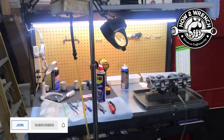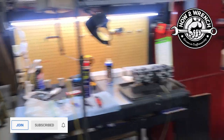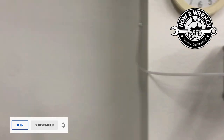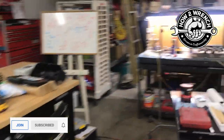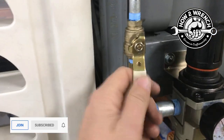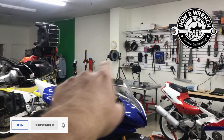The one thing I didn't have that was getting annoying was a dedicated airline. In my last shop I had a dedicated airline on the carb bench, which is crazy useful. I was having to drag the line all the way over here and got sick of it. I've made some videos on how to use this quick airline. Up in the ceiling I put a T, ran it across the ceiling — hence another reason the bike needed all the towels over it — and popped it out over here. I put in a line with its own shutoff; now I can regulate it down. You don't need 90 PSI at the carb bench.